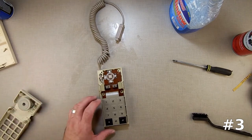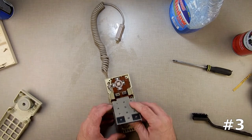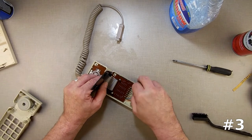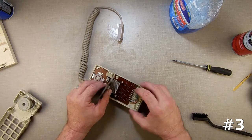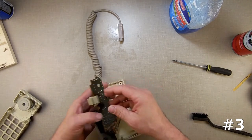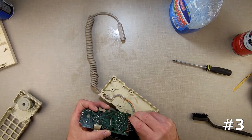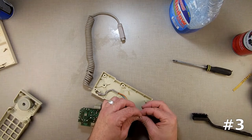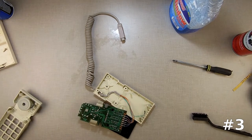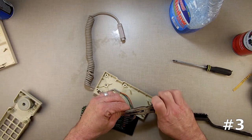Some of these — the ones that have bad keypads and stuff — I'm going to test along the way off camera, plug into the Adam and make sure everything's good. This one's right button sticky. Now, see this? See how it's moving there? That could be your issue — the rest of these are pretty tight but that one's moving. I don't know if you can see that. These, if they're not seating well — see, the rest are pretty good but that one's moving. Can I tighten that? This metal is very fragile. I just want to close it up a little bit without crushing it.